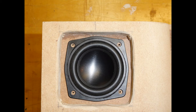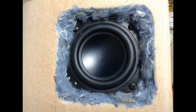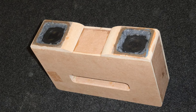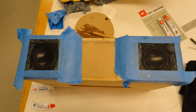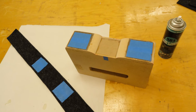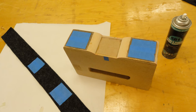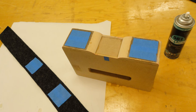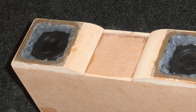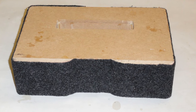But if you want the super stealthy version, you'll do what I did for mine. This requires an additional panel for each driver to basically inset the driver a bit so the carpet doesn't touch the cone as it moves. You'll need to install the driver and test that it works and that it's airtight before proceeding. I added a little ultra-touch denim insulation in this area to minimize diffraction, and then covered this with some window screen material to give it some additional strength where the carpet stretches over the driver opening. I used epoxy to do this and used blue painters tape to hold it down until the epoxy set up. Test first, glue second.